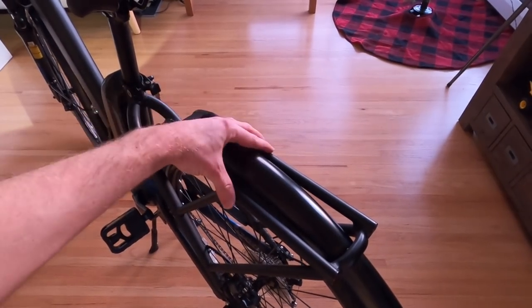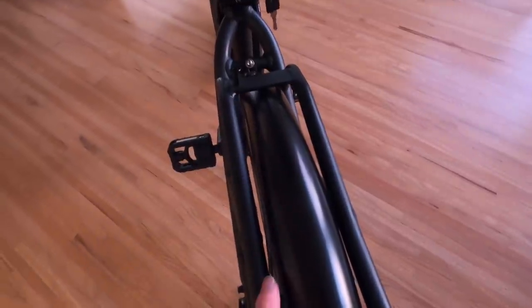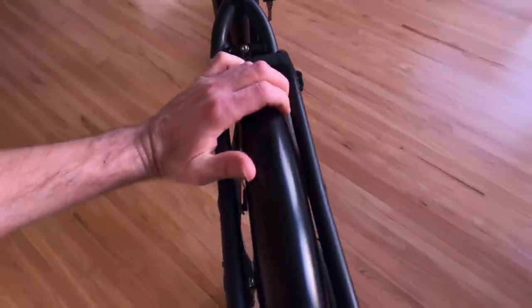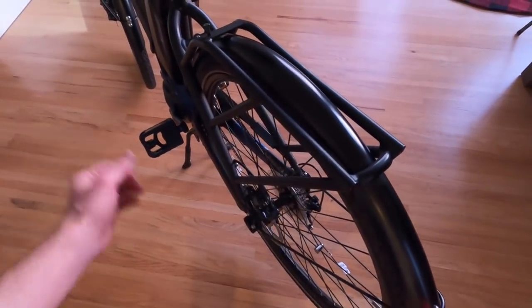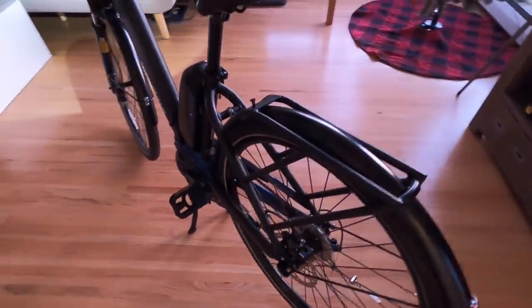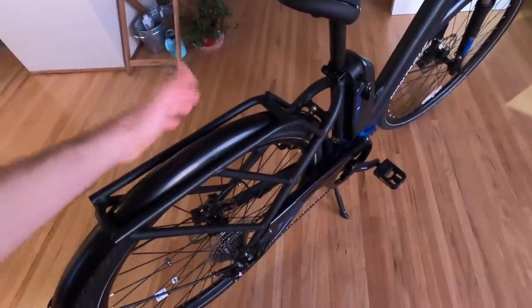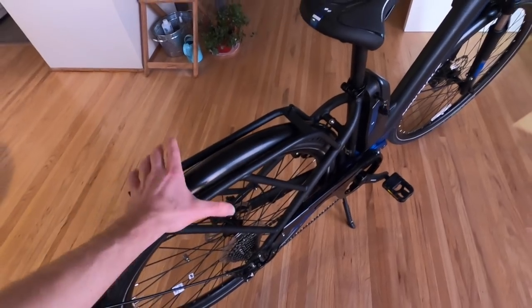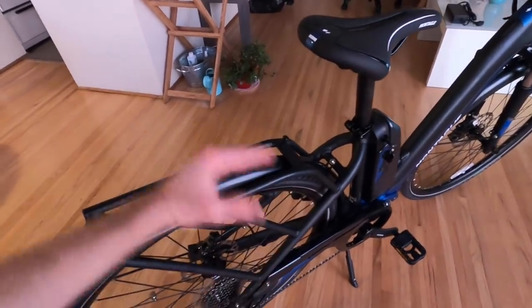I don't think this rack is really designed for a trunk bag — not wide enough, no solid platform, and the tubing is a bit wider than normal. For panniers, you might need the hangover style and velcro them to the side bars. I don't see a weight rating — probably around 55 pounds is standard for bolt-on racks, but I'd play it safe and stay under 40 pounds. It's positioned well enough that you can lower the saddle for low standover while still having room for bags.